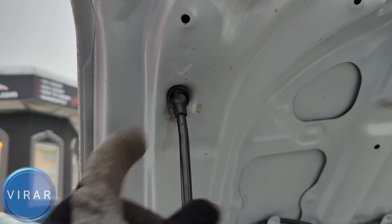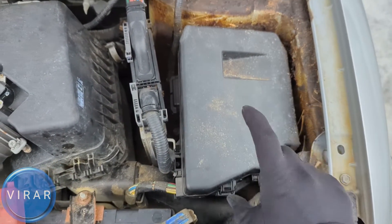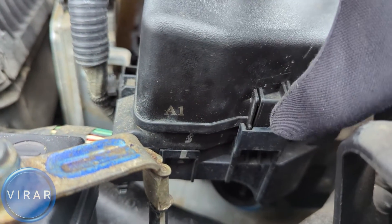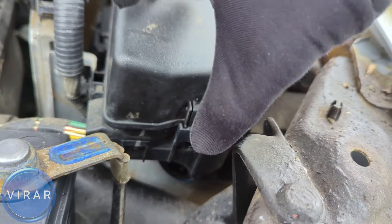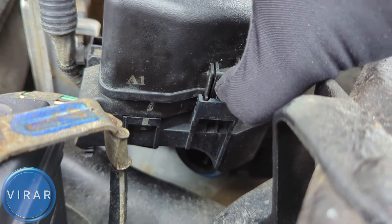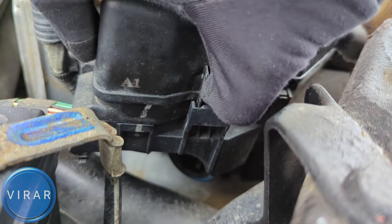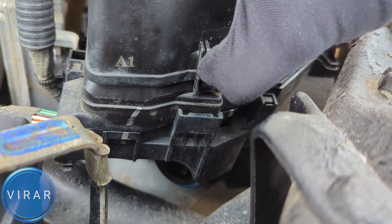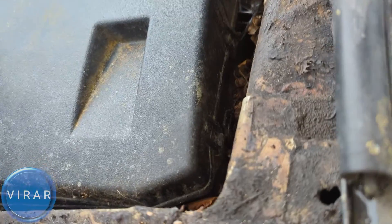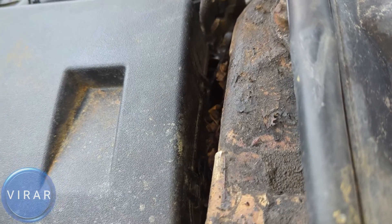Pull it back and now the hood is secure in place. Once the hood is open, that right there is the main fuse panel cover. We have to get it off. Press on the clip right in the front — just press it in with your thumb, and at the same time try pulling the cover up. There are two clips on the back side, so lift the cover at an angle and push it back to get the entire cover off.